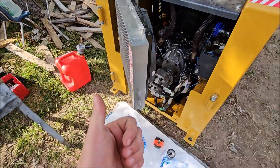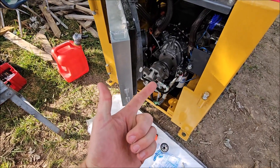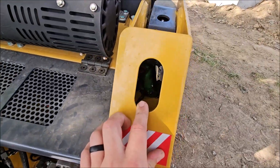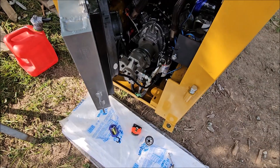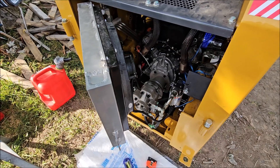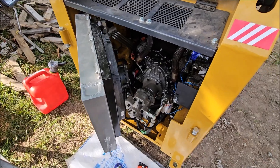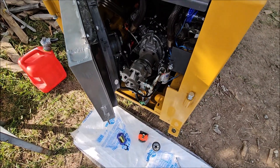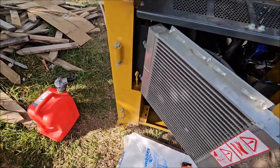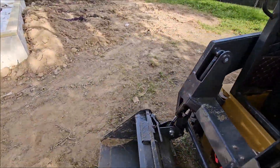So to summarize: change your grease zerks, change your engine oil and hydraulic oil and the filters, get rid of all the rub points on all the hydraulic hoses, do something about all the electrical lines that are going to get burned up by touching the exhaust and the cylinders and the overhead valves and all that stuff, and make sure your fan works or add a fan to it. I hope this video helps — thanks for watching.